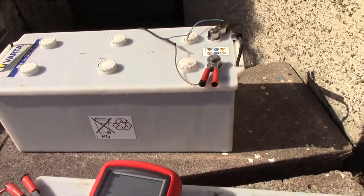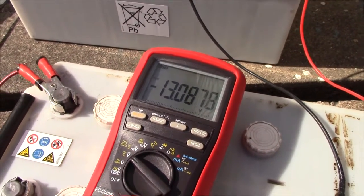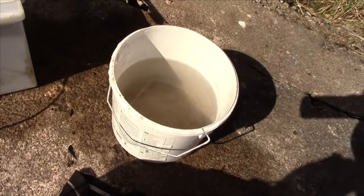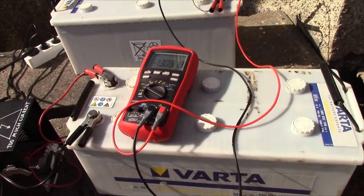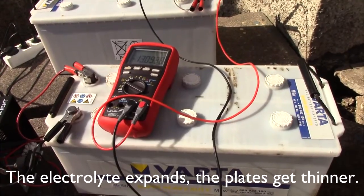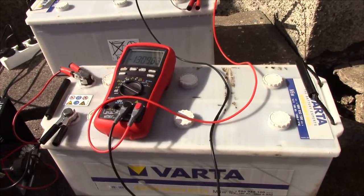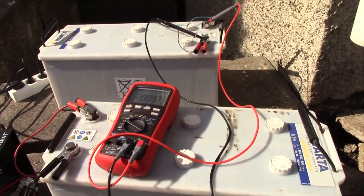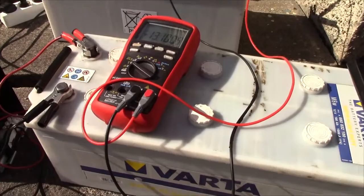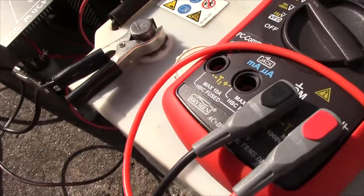I've just hooked up a couple of chargers and they seem to be swallowing current quite well. This one's charging at maybe five amps or so, and the other one's charging at the full six and a half to seven amps that my normal battery charger can do. The reason I'm charging them before putting more water in is that you should never, as most of you probably know, put water in an empty battery, because the plates expand when charged and you run a risk of overflowing.